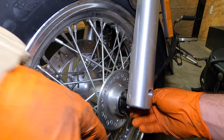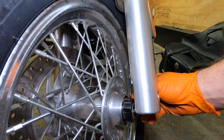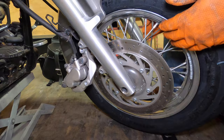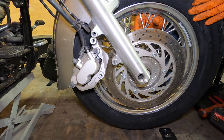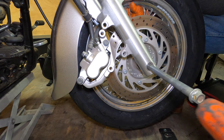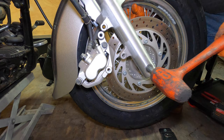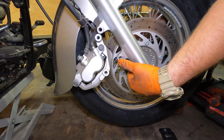See how flush it is. Right here you'll see this notch inside this pickup — there's a little tab right here that needs to go inside that, which keeps this from wanting to rotate. So make sure you do that when you put the wheel up. Get the speedometer pickup in, straighten the wheel out, get our spacers and stick them in. Lift up the wheel, slide our axle in. Make sure that tab goes in that slot. Line all that up — there we go.